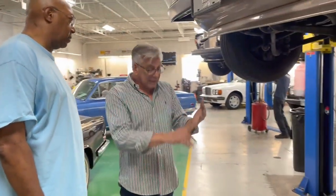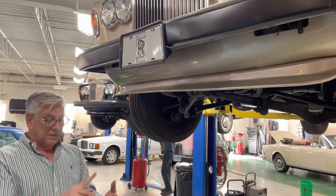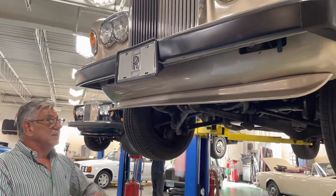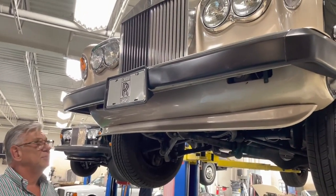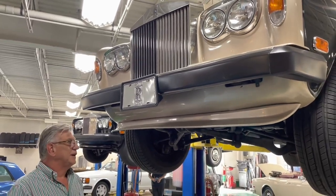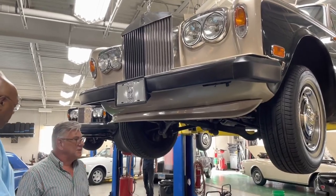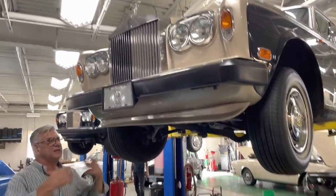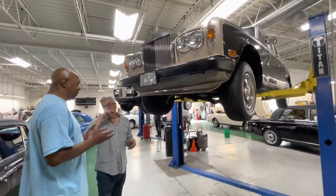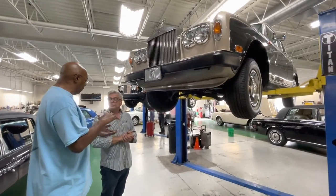We clean the reservoir. We check that the brake pumps are working properly or if they're leaking, and we fix them. The accumulators need to be able to provide a minimum — in terms of a good satisfactory system — 40-plus depressions on the brake pedal before the light comes on. Brand new, you may get 80-plus, sometimes 100. They have accumulators now that are actually better than the original ones, and they're small.